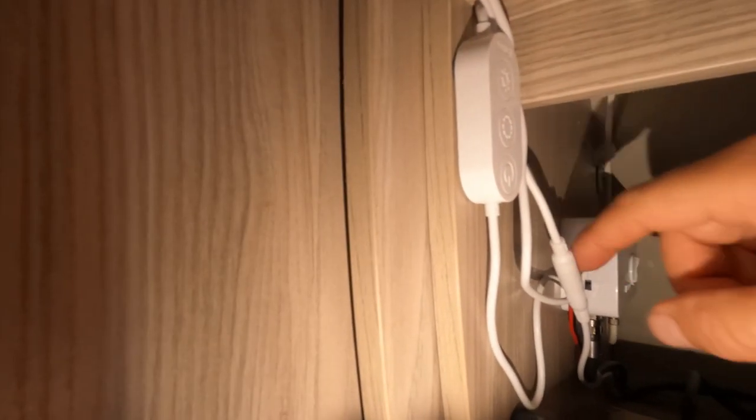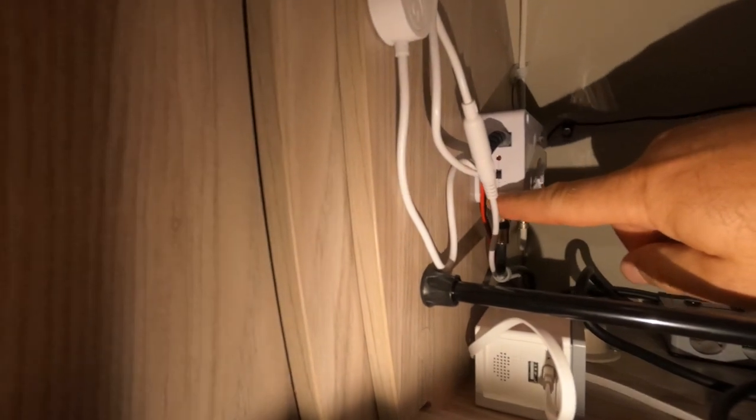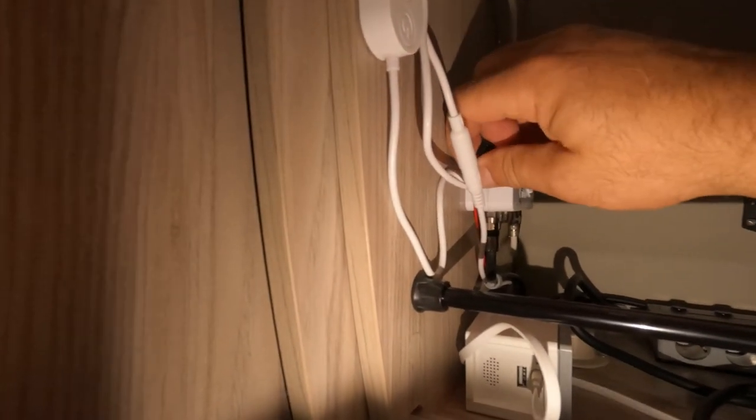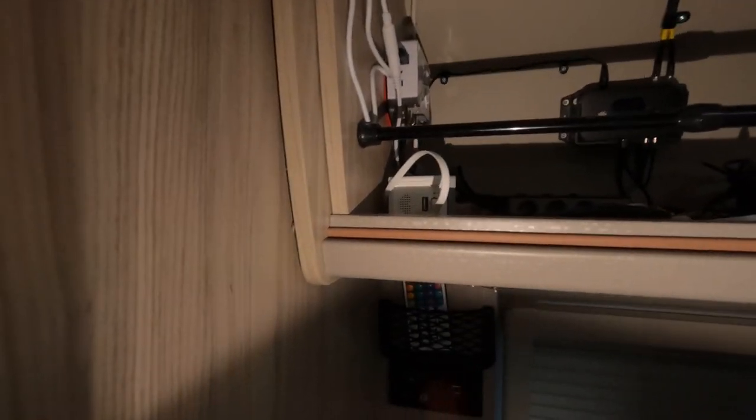There's the control box for the lights. When you cut the plug off the wire, that's where I wired it in. All I did was splice into that red and black wire because that's definitely 12 volt — it feeds the TV booster. I spliced into that wire and that's it — that's the 12 volt supply. Check out my previous video if you're interested. I can really recommend them. And it doesn't affect my TV signal either, so don't worry about that. You just need to find any 12-volt feed, but that's where I got mine.